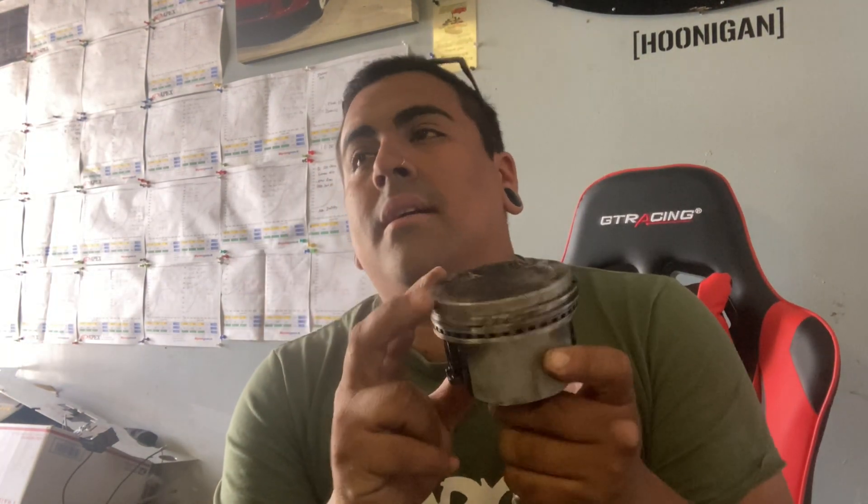You're going to see at about 12 PSI on E with stock cams, you should be seeing anywhere between 420 and 440 horsepower. We have not yet been able to record a 2JZ GE VVT-I with cams on the dyno, but the general increase of power with cams on a turbocharged car is about 50–60 horsepower based on tuning a lot of cars and seeing no cam versus cam. I'm going to show you guys a few things we have here, and that's going to end the video.